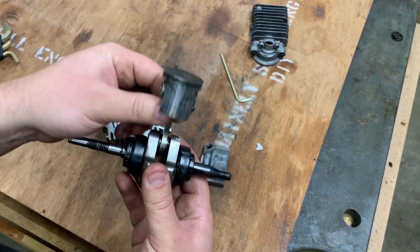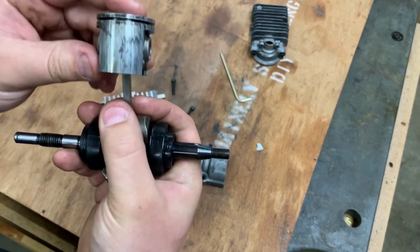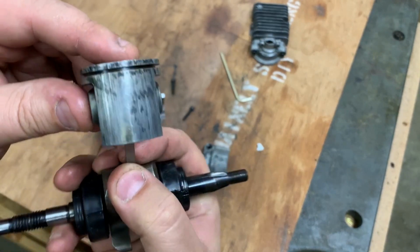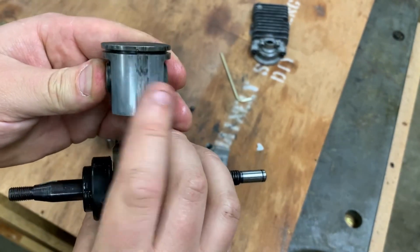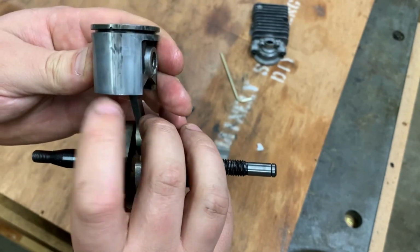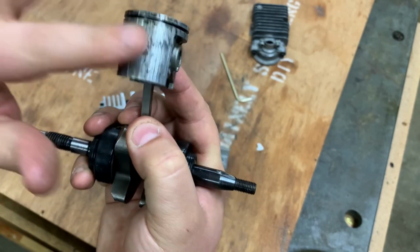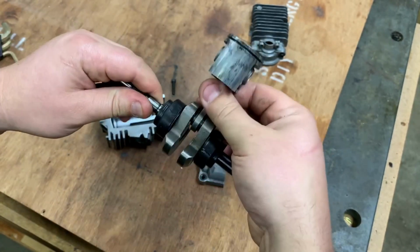So now what we've got here is the crank assembly. And if you recall the first video, I will put a link in the description of that if you want to see where this came from. But this again came out of a Homelite, and it was pretty badly scored. It's not worth saving this. Even this right here, the intake side, had some scoring on it. This is the muffler side, the exhaust port, that had pretty bad scoring on it. But the rest of this was in pretty good shape here.